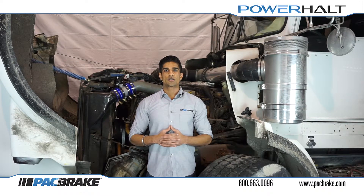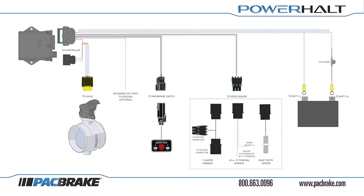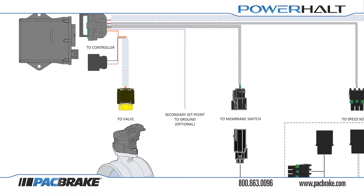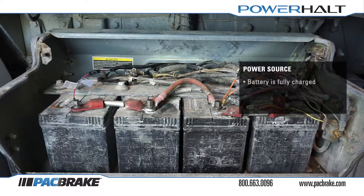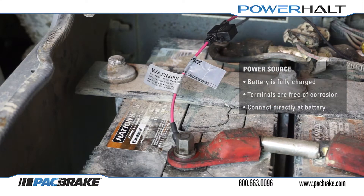The PH3 system is able to force shutdown at a secondary set point. If your vehicle is equipped with a PTO or power take-off capability, you may want to take advantage of this feature. To activate the secondary set point, you must connect the purple lead wire from the wiring harness to ground using your PTO activation switch. Ensure that the system is provided a good, clean connection to a sufficient power source. Voltage drops due to corrosion can result in error codes being triggered. We recommend drawing power directly from the batteries.